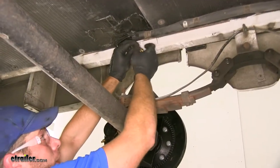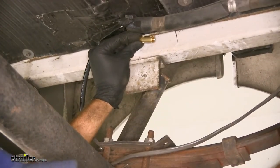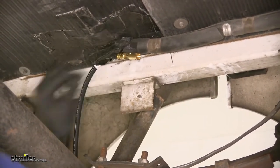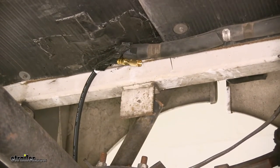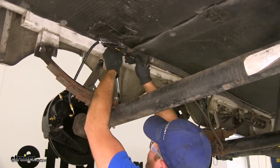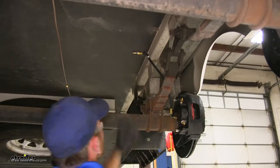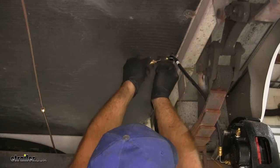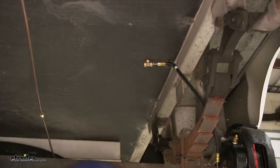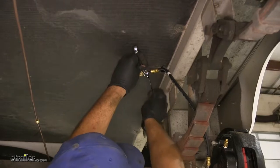In this fitting we've got a union, which is just a straight pass-through. We'll get our next brake line measured and either coil and attach it, or use the double flare tool to make the line the appropriate length. Then we'll make our cross run from the driver's front over to the passenger side front, using a T-fitting at that forward location to replace the four-way T used on the driver's side.